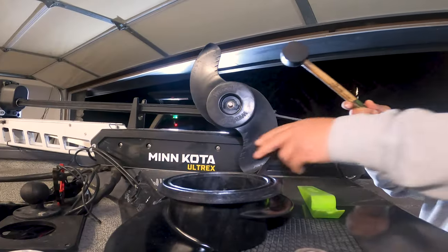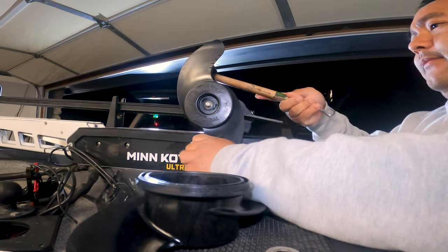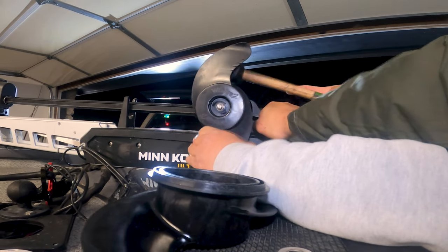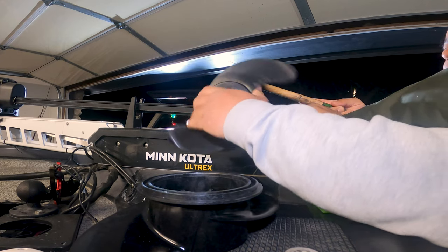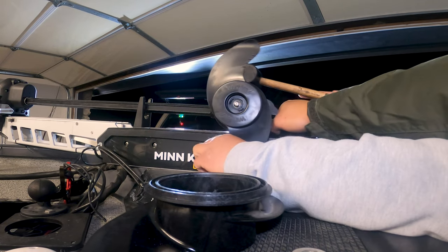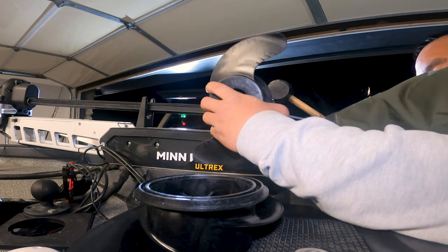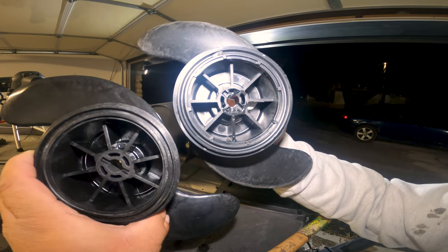Pry tool. Back with the hammer. Man, it's strong. Maybe it works, right? I mean, it's slowly coming out, but... Hey! Let's see. There it is. It's like a key. You see that? Yeah, that's probably a good picture.